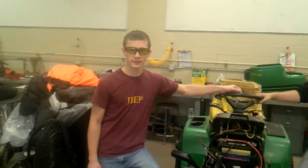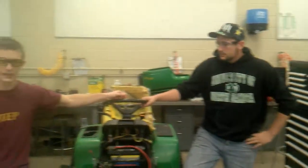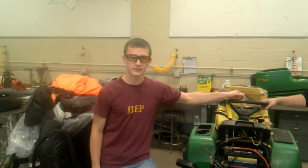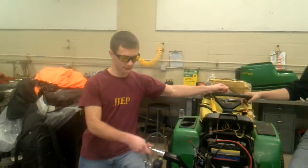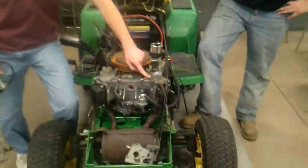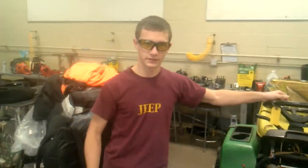I'm a student at WITC, and today my assistant Adam and I will be doing a how-to video on pressure testing a coolant system to check for leaks. The coolant was leaking around this gasket here and into the intake manifold and down into the cylinders, so we were getting a hydrolock and the engine wouldn't turn over.